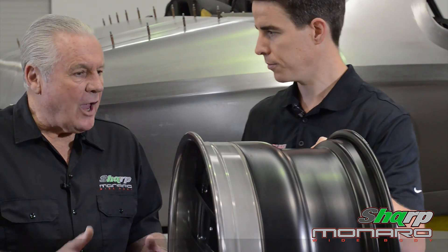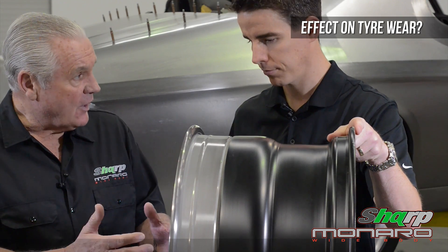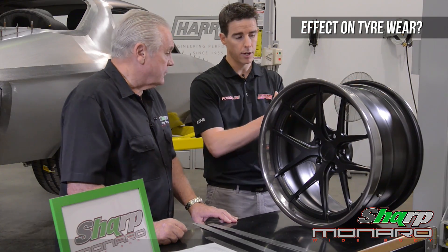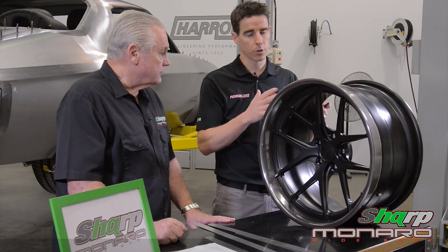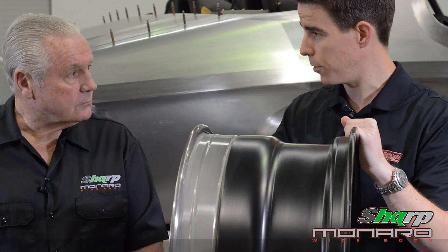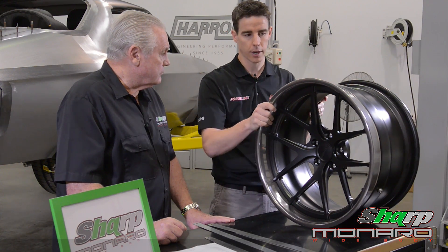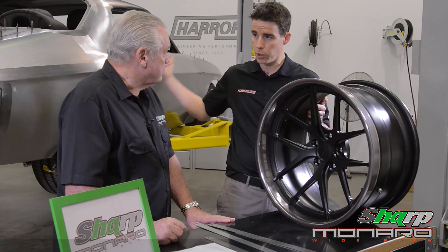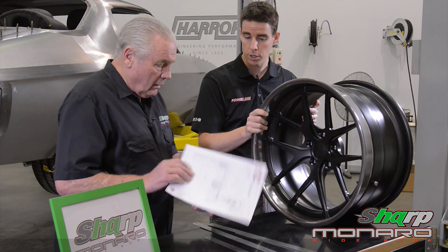Would I have to alter my geometry — my toe in, toe out, or camber because of that? Well, it depends on how tight we want the fitment to be on your car, and also what it's being used for. If you've got a cruiser and you want to drive up and down the east coast like Peter with the HQ, you're probably not going to want to go really aggressive on camber and cause uneven tyre wear. The best way to assess the wheel fitment is to actually look at the wheel well and the packaging constraints. We'll take the wheel off Peter's car and look at how we actually take the measurements using the form that's available.